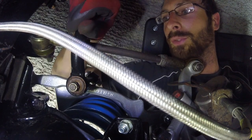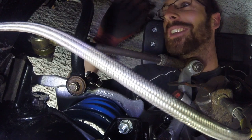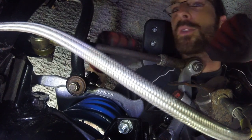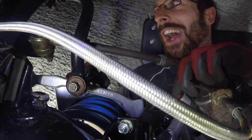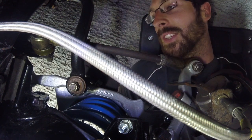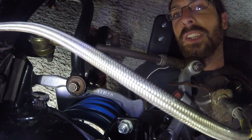As you probably know, the anti-roll bar connects both sides and stops you getting body roll. Now you don't want to connect both sides too hard with a bigger anti-roll bar, because then there's no point having independent suspension. But I forgot — if I do the bar on the other side first, it means I can't get this guy in because the two sides are connected. So I've got to undo this guy again, fit it on the other side, then come back and put it on. It's been a long day, I'm getting tired — clearly.